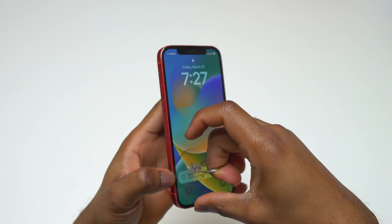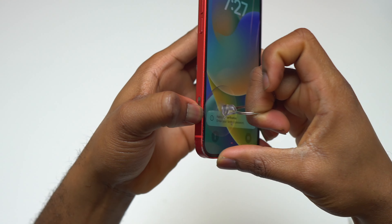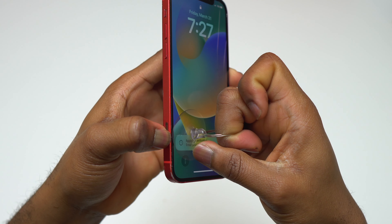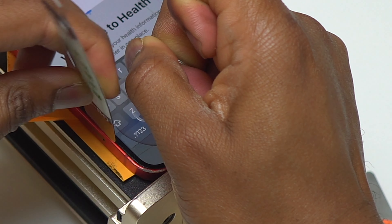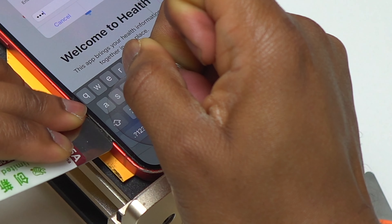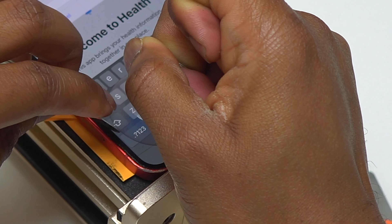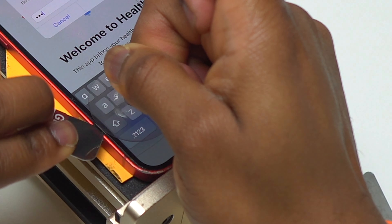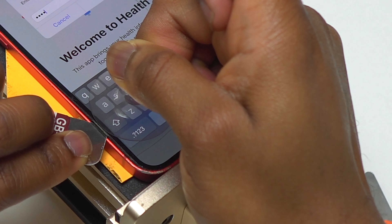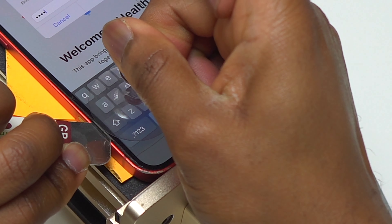I heated the screen of this device with the lowest setting on my heat gun. I heated the front of the device for at least five minutes, moving the heat gun around the device and primarily directing the heat gun at the body. The device is being held by a tool I got from Riwa Tech. This device has a broken screen — the glass on the front is broken but the screen itself is good.